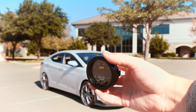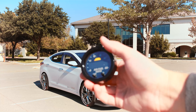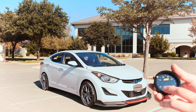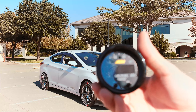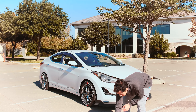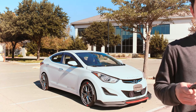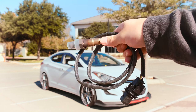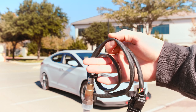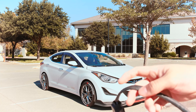That's definitely going to be cool because I already know I've been running lean lately. Just as a hint before we show it in the video later after the install is complete with the gauge pod — I actually was running lean. I wanted to test this out yesterday and I wanted to make sure it actually worked with my car, and it does, so you guys will see those numbers. The buttons on here are not rubberized, they're tactile, so you don't have to worry about them getting stuck in the seasons. I decided to get this version because when I get to my supercharger project later, I wanted a faster sensor. This is a really super fast responsive Bosch sensor, which I'm not going to use now because my current Denso sensor is pretty responsive already — this will just be ready when I want a new one. You also get extra length, which helps with bigger engine bays and gives you more working room with your harness.